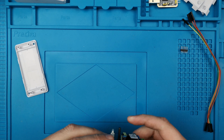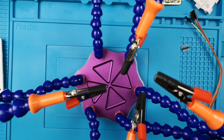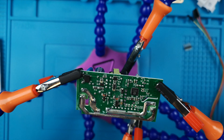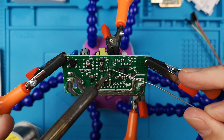First let's open the device. The first step is to remove both covers — just remove the four screws, and then with another screwdriver you can open the case. You don't need to remove any other screw.